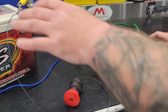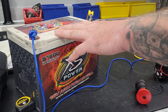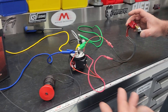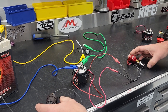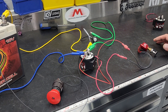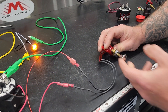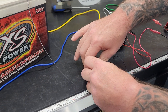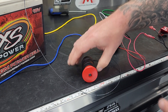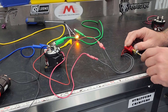With this setup you can mount the battery up front. It doesn't matter what battery it is — you mount the battery up front, you can mount the contactor right next to it, and then have a switch, whichever you prefer. Whether it be the push-pull on the back bumper and the E-stop inside, or vice versa, or two of the same. I like these because the push-pull has a good tactile feel and the E-stop is a really rock-solid switch with a hard click to turn in and out. The mushroom button is great to slap to turn off, and these are nice low-profile switches for the back bumper.